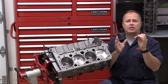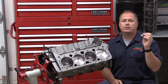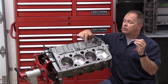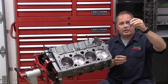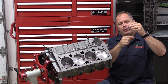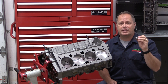You really want flat tappet clearance between 0.0015 and 0.0017 — that's the sweet spot. Russ says you can actually go as wide as 0.0013 to 0.0019 of an inch. That's a lot tighter than the two to three thousandths that a roller lifter can use, and the reason is you don't want the flat tappet lifter to be able to move much in the bore. A flat tappet lifter has to rotate or spin to keep everything working properly when the cam lobe comes by, and it has to be nice and tight — otherwise if it's loose, it won't spin in the bore and worse things can happen.